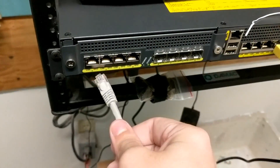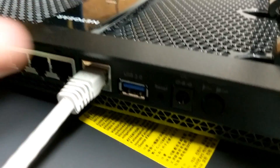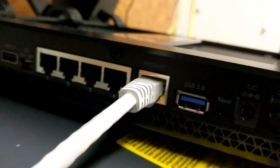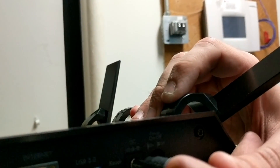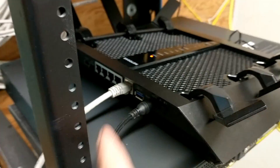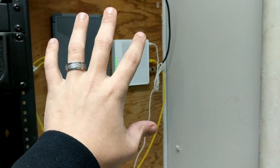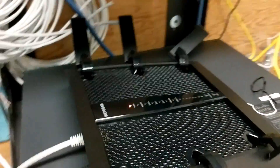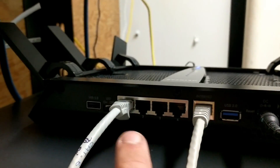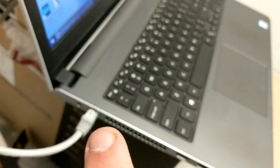For most of you, this cable will come from your Comcast modem to your router. For us, it's actually going into the firewall here, and then that plugs right into the bright yellow port on the back of the network device. The other end of the power cable is right there beside the USB 3 port. This is a slightly different setup — just a reminder, your internet port at your house will have this cable plug in here and go to the back of your Comcast modem. This is a gigabit network so there are two devices — it's a little more complicated. Either way, just make sure your cable goes from your Comcast, AT&T, or whatever modem directly into the yellow port on the back of the Netgear device. If you don't want to use wireless, just plug your network cable into any of these four ports — that cable should run down right into your laptop, as long as you have the proper network adapter.